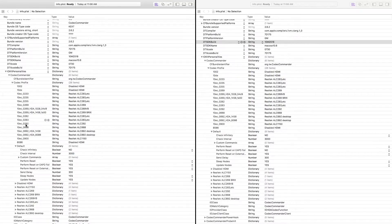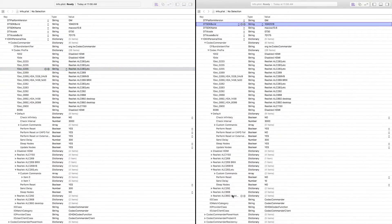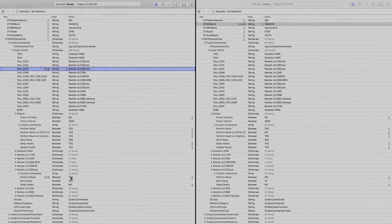Also look at your codec. You need to reset if it's ALC Realtek. Mine is 255 and it uses the profile ALC 283. Look at it — ALC 283 — and 'Perform reset' is set to No. You need to change this to Yes. Reset everything — change it here. Thank you.